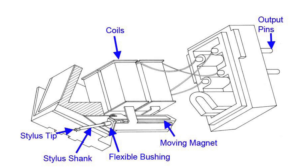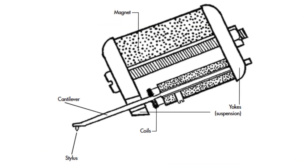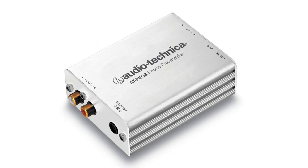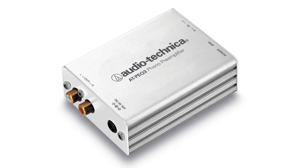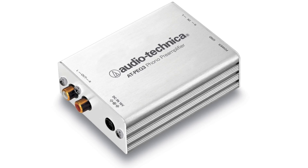This is where a moving coil cartridge has performance advantages. A moving coil cartridge is sort of the opposite of a moving magnet cartridge. Instead of magnets, two small coils are connected to the end of the stylus, located in the body of the cartridge. The coils are smaller than magnets and weigh much less, giving the stylus more agility when navigating the constantly changing record grooves. In general, a moving coil cartridge traces the grooves better because of its lower mass, providing more detailed and accurate sound quality. One disadvantage is that it generates a smaller voltage and requires a secondary amplifier, sometimes known as a head amp or pre-preamp, which increases the voltage enough for the phono input on the stereo component.